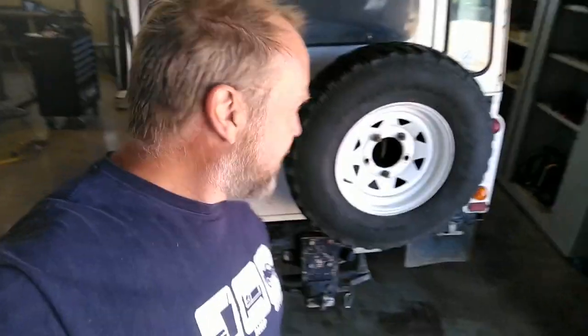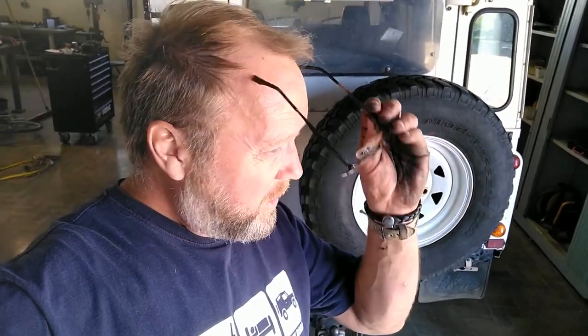If you have your clutch pedal working properly, no big deal, right? When suddenly it goes down halfway and it becomes really hard, and you've got a little millimeter of play to get it in gear - that's probably not how it left the factory. What we got here is a little issue. We've tried to look at the master and slave cylinder, checked the oil. Those are all functioning properly, so we suspect it might be a thrust bearing.